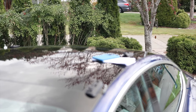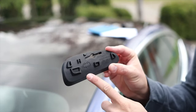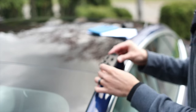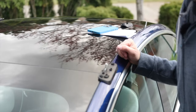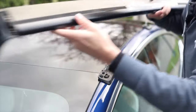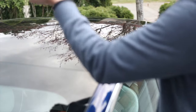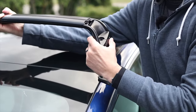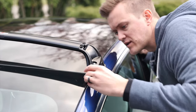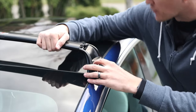Now that you have all your clips on, come back and put the rubber piece back on — as simple as it looks. Make sure you have the right one: on the picture, one clip looks different than the other three with an arrow pointing forward — that's how you know which spot it goes on. Just slide it right over top, then do all four. Next step is to put on the actual crossbars. The arrows show which direction they go, and on the front side these are bigger than others, so the larger one goes on the larger pad. Lay them on first, align them — maybe have a second person help. Everything fits perfectly when in place, with two little parts that go into the rubber pad and then the bolt goes in right there, perfectly firm.